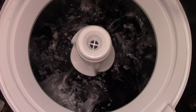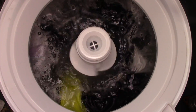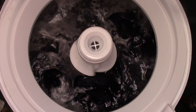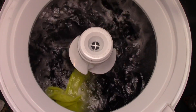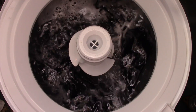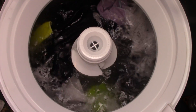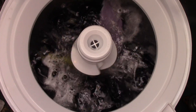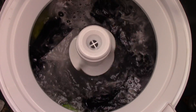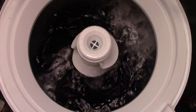The reason it's such a great washer is because it was so durable. Now, there's a difference between durability and reliability. This washer will not last forever — you should expect to do some sort of service every 5 to 15 years depending on how you treat it. One of the weak spots was the motor coupling and the clutch. The beauty is that you can totally fix it yourself, or if you hire a service tech, they won't charge a lot because it's such a joy to work on and so easy to repair.